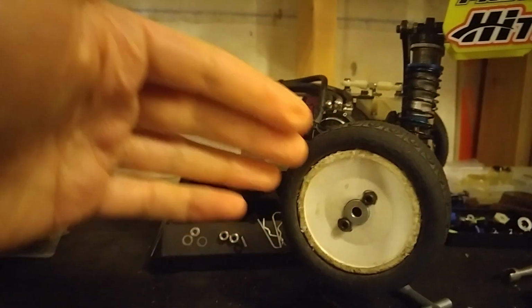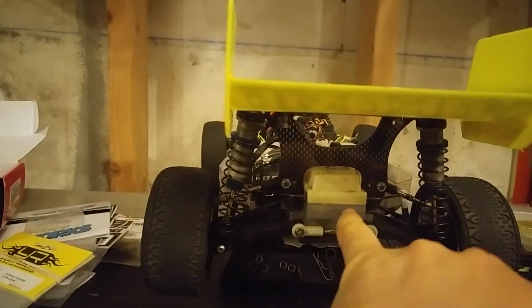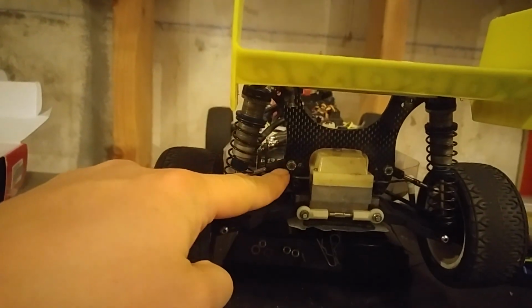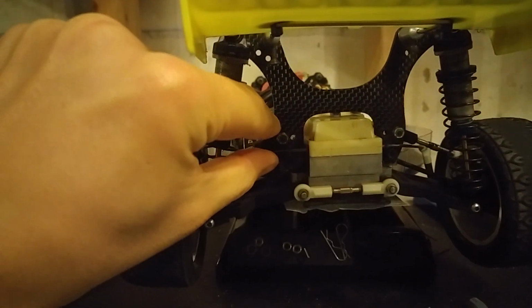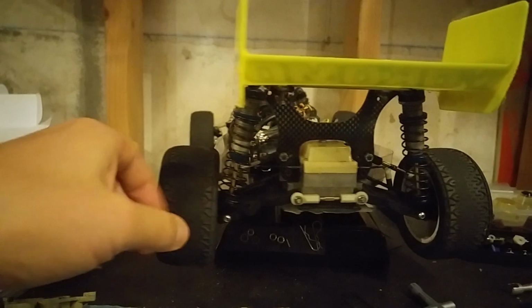Another option would be if you can get some kind of a plate here, like if you look, for instance, on the 93 WCS, that had an actual plate that went between the bulkhead cap and the bulkhead, so that instead of the inner camber leg mounting on the tower, it mounted on a vertical plate, and you could change the vertical positioning of that camber leg mounter, that bolt set with spacers. Okay, so anyway, on the rear, move the hub carrier down. It'll give you more ride height, essentially, at full droop.